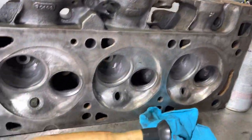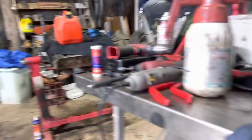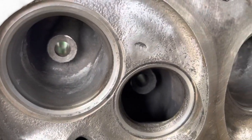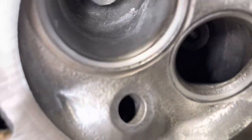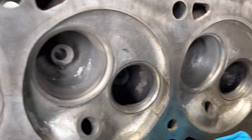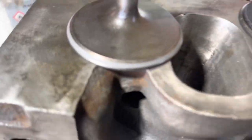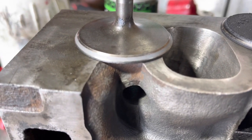There's the 2B heads open chamber. Now that we're deeply involved, we're just doing a bit of valve lapping. You can see on those valve lands there — nice and smooth. You can see on these here, they're not too bad, but we'll give them a touch up. These are the valves here. Zoom in — you can see on those lands and those valves: nice and clean compared to the old ones.